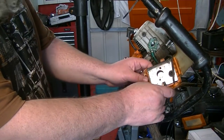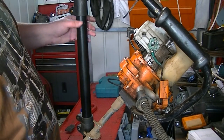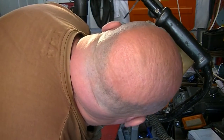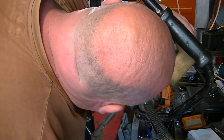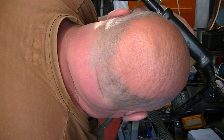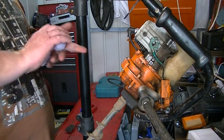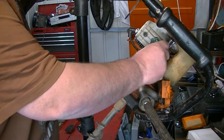This is to your primer. I'll have to clean and fit it up before I put it back on. The plug is loose so there's no real compression there. The piston looks really good — it's got a few lines on this side and a bit of a deep groove on the other side, so it has got a bit of wear on the rings. I think it's got a compression of 125 — ideally it's about 130. I think that's fine.